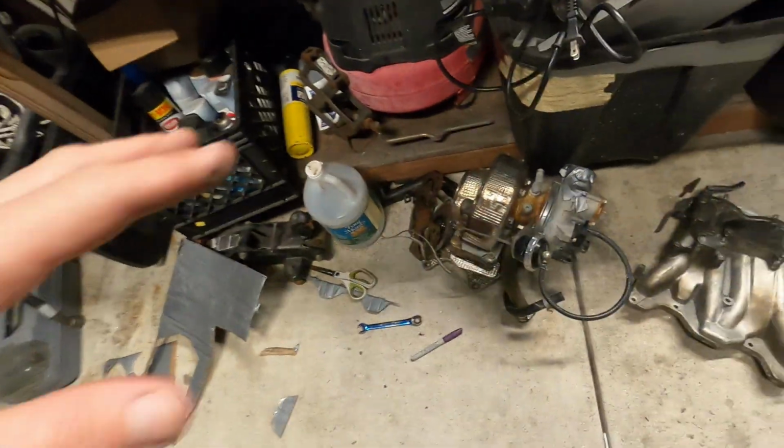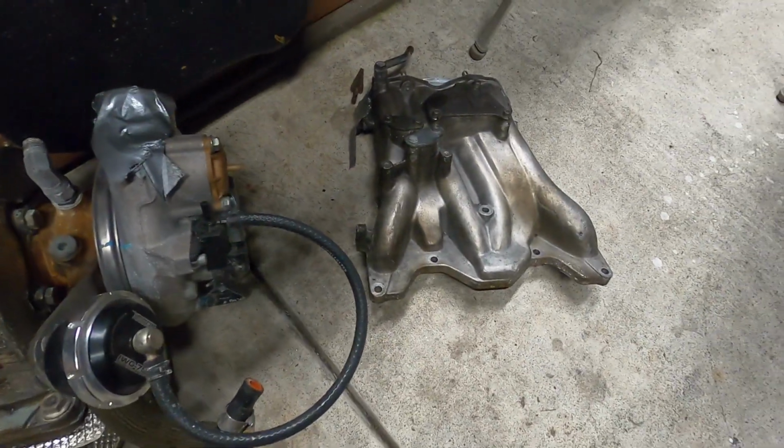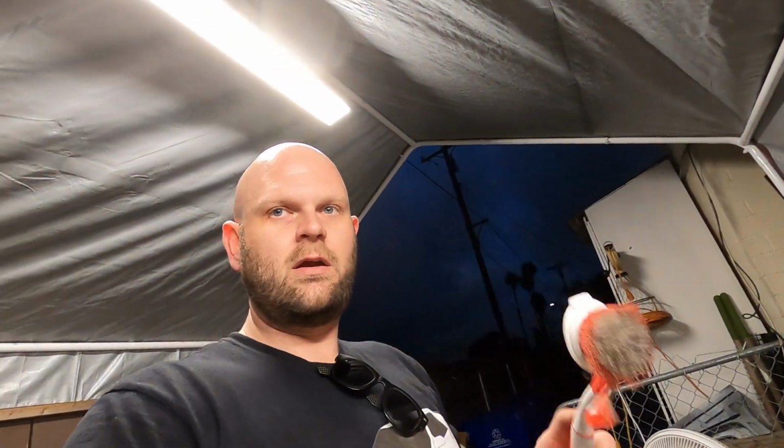So I'm going to go ahead and wheel it over to the area where my hose can reach. I'm going to take over the turbo and the intake manifold as well, and just start to get those things soaking in degreaser, cleaned up. Just going to use a scrub brush, like this guy right here, some Scotch-Brite, and then on the aluminum pieces, depending on how they clean up, probably the wire wheel, and get everything nice and pretty.